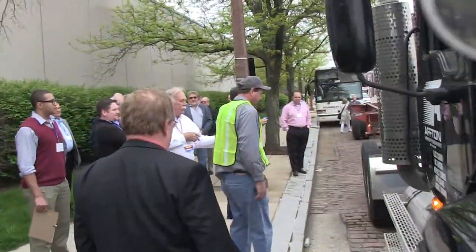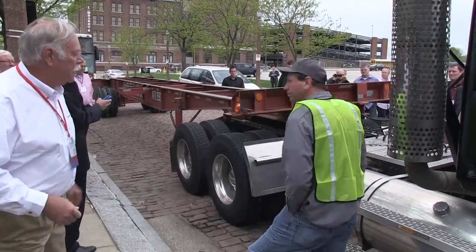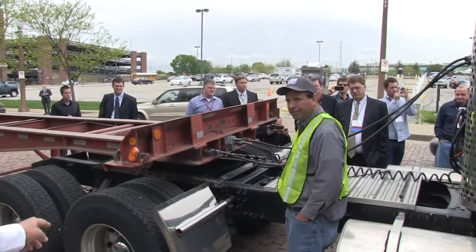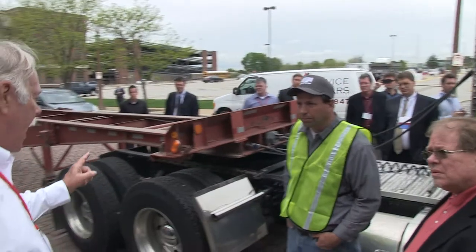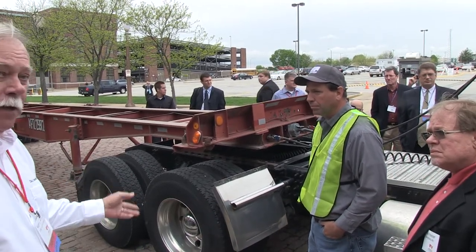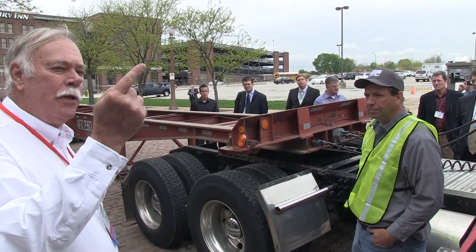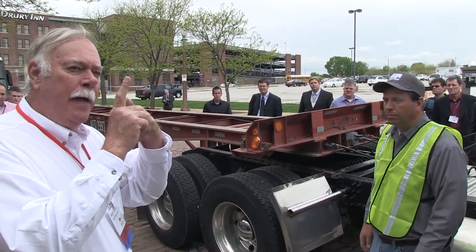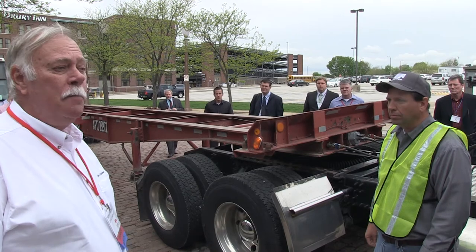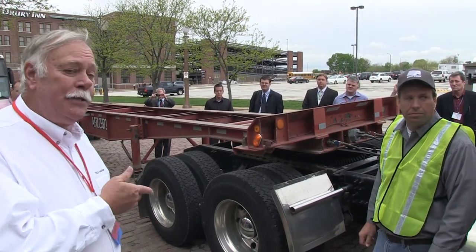His next area of interest is the hoses — making sure they're hooked up correctly, not laying down, in a proper position to supply electricity and air to the trailer, and not running on the catwalk where they could chafe. He then inspects axle two on the right side — the wheel, lug nuts, tires, and tread — and crawls under to check the slack adjuster manually for pushrod travel. Some drivers use their index finger to the second joint, about an inch and a half, to gauge pushrod travel. If it's at that point or more, when air is supplied to the system, the brake actuator will travel another half inch — giving two inches of play — and the brakes will need to be readjusted.